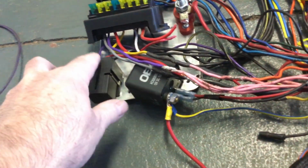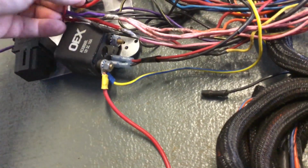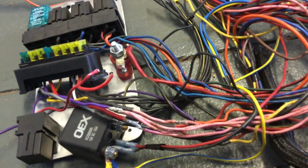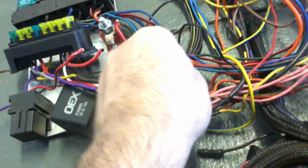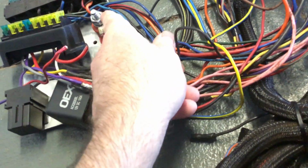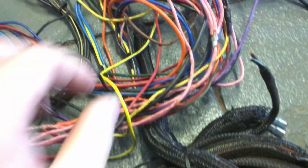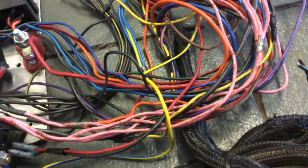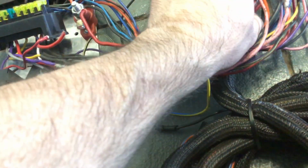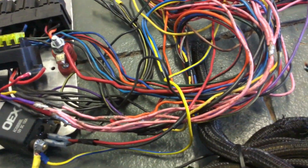Goes to this relay, and then the power for that relay went to the panel, went to here. I've had to cut them to pull relays off when we started rewiring to try and help this car. And then from there, this lead here, this big thicker one, that goes directly to key. So between that panel, that post, 150 amp post, God knows how many cranking amps go through that goes to the back of the key. With no protection. There's no fuse. There's basically nothing. No fuse. No fusible link. Nothing between it.